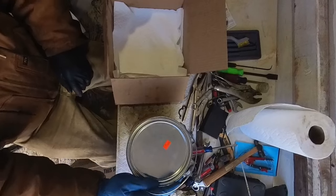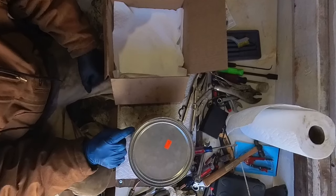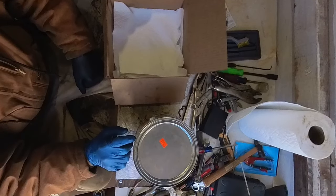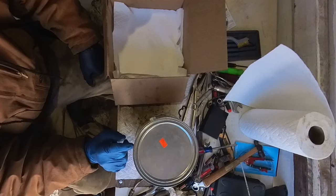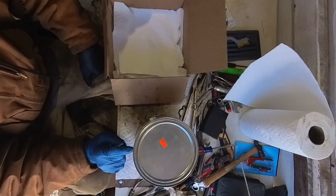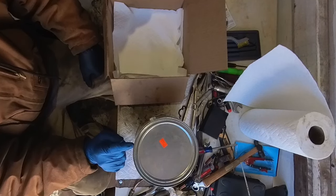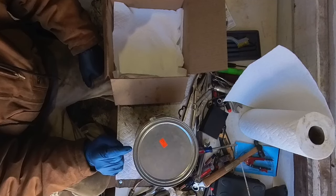The direction says to let it soak overnight for really dirty parts and to rinse off with water once you pull them out. Berryman Chem-Dip Carburetor Parts Cleaner is a highly effective carburetor parts and throttle body cleaner that removes gum, varnish, fuel residue, and other deposits from carburetor parts and throttle bodies in 15 to 30 minutes without heat, aeration, or agitation. Safe for use with most plastic and metal carburetor parts and throttle bodies, including steel, aluminum, and their alloys. Limit soak times of coated and sensitive aluminum finishes to a maximum of 4 hours.